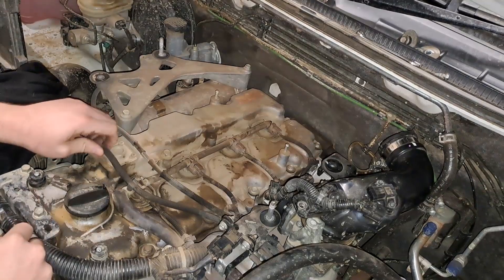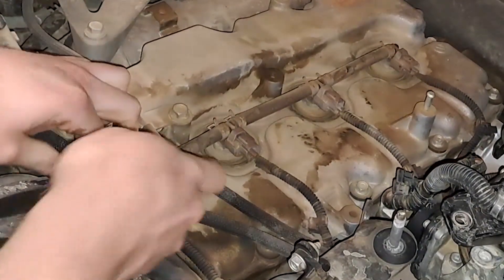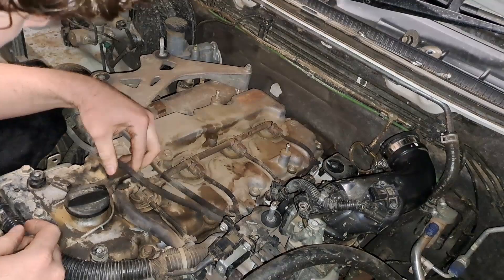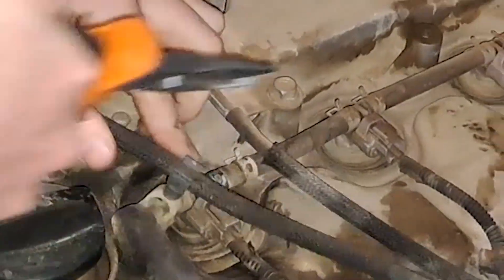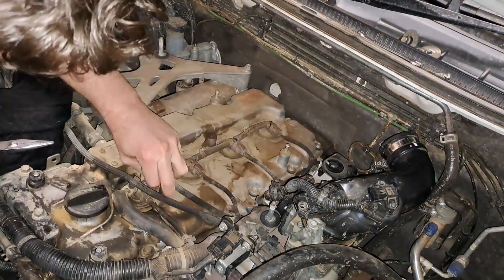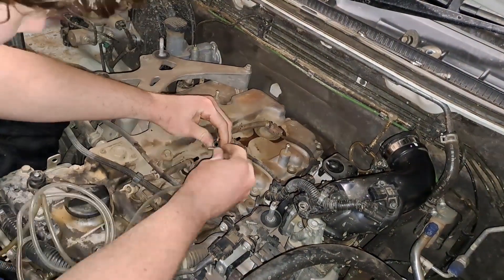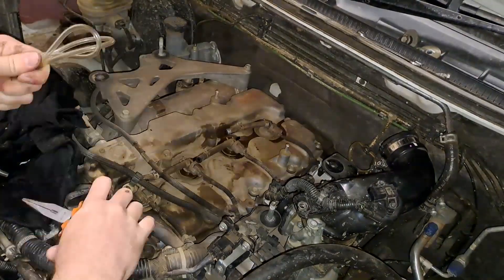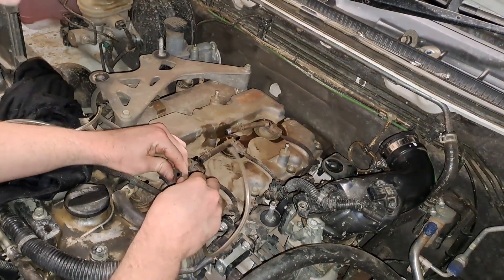Now that the intercooler is out of the way, you can actually see where your injector piping and electrical connections are. All these you want to take apart, but carefully — these fittings break so easily, it's not even a joke. And don't even get me started on finding these fittings. All I use to get the clamps off these pipes are some long-nosed pliers and some very gentle coaxing. I decided to get some extra hose and pop it in there just so we've got some extra length to work with.